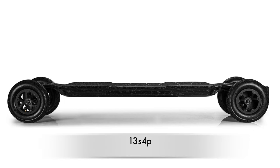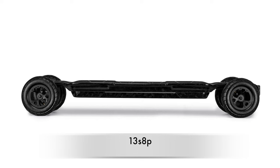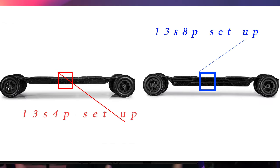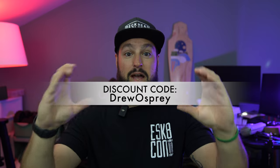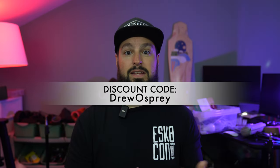The reason I say this deck is the most integrated feature out there right now is that the actual enclosure is underneath, mounted via screws, and allows you to lower and raise it. This lets them fit either the 13S 4P — which is what I have — or the 13S 8P, which is an insane battery size, without changing the enclosure. You just adjust the screws to fit a bigger battery, no need to purchase a different deck.